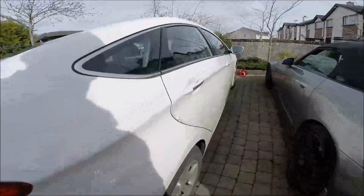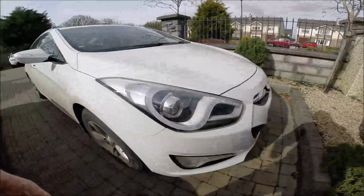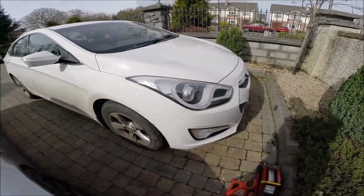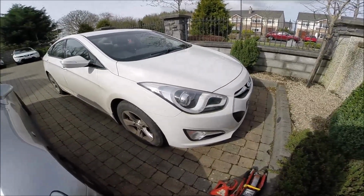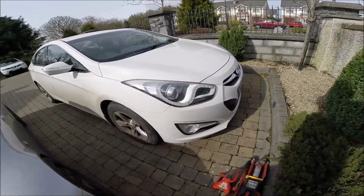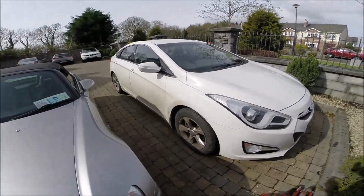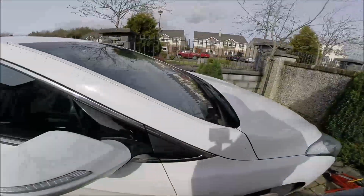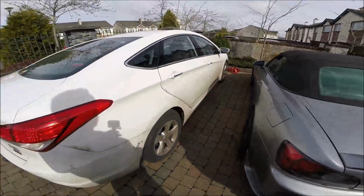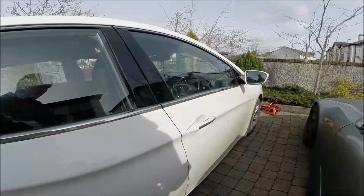A40 problem with the fan belt noise, but this is a little funny problem because the noise is a very high sound, squeaking, and the grease on the belt was not fixed. So probably the problem is in the alternator pulley, I think, and we will check this and replace it.